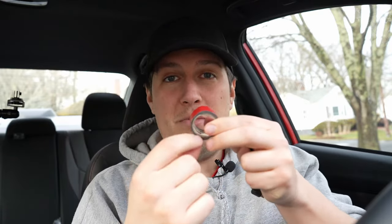I'm going to get this set up before I actually adhere it, just to make sure it works — the last thing I want to do is put 3M tape on the car before testing. I'm using 3M tape rather than double-adhesive velcro because proper 3M tape is actually easier to remove than velcro products. The adhesive is thicker, which counterintuitively means it holds harder and longer, but it's actually easier to get up. I've removed enough of this stuff that this is definitely the way I'd go.